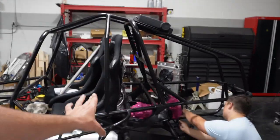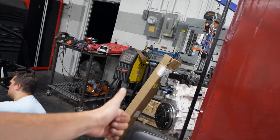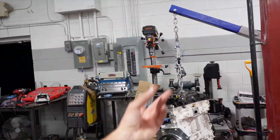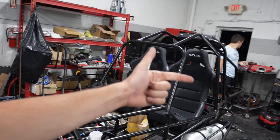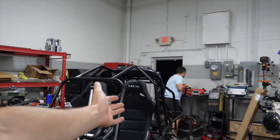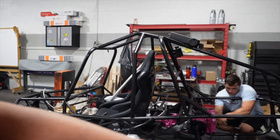Once the transmission is set in place, we're going to throw the motor on. I think in the next video we're going to put in the motor and throw on the turbo. After the motor's in, we'll be able to finish up the fuel — run the fuel lines completely. We'll also be able to do a lot more electrical hookup. We've been prepping for that and most of it is done and ready to hook up, but we still have to lay all those lines and make sure they fit. After we do electrical and fuel, once the motor's in, can we fire her up? We do have to do a few random things like charge piping, hooking up the radiator, the intercooler. We are also ready to do brakes whenever we take the time, but that's a big project.